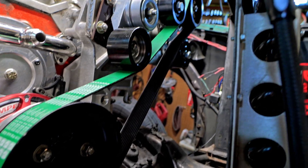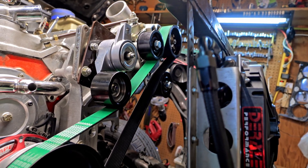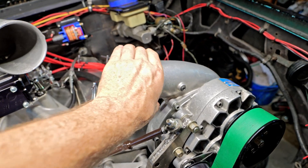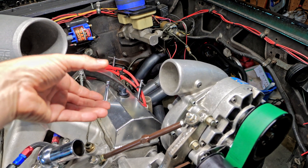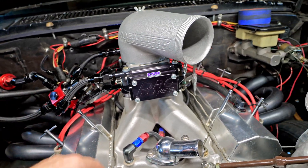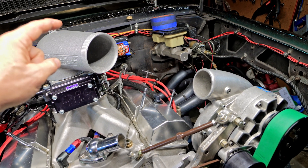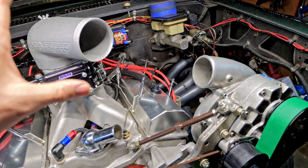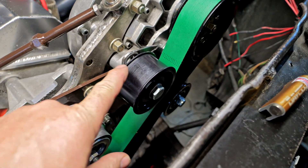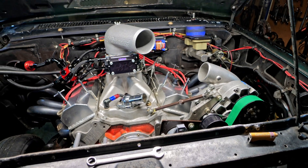Take a look at the whole setup — I think that's going to do a much better job at preventing belt slip. I don't know if it'll completely eliminate it, but that's the hope. Next I'm going to get the piping tacked up, figure out the blow-off valve, tap the intake, and then drop everything off at the welder's house so the welds actually look nice. What do you guys think? I think this will probably do a lot better job at preventing belt slip — we're going to find out. Until next time, don't forget to subscribe and peace.